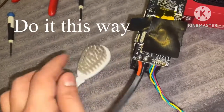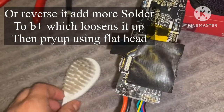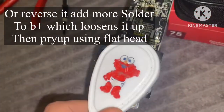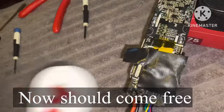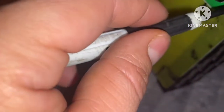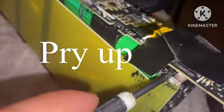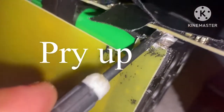Heat this up, and before it has time to dry, get your brush in and throw that solder away — just knock it off. I use a flathead, put it in here, and pull up on it until it breaks the connection between the BMS —